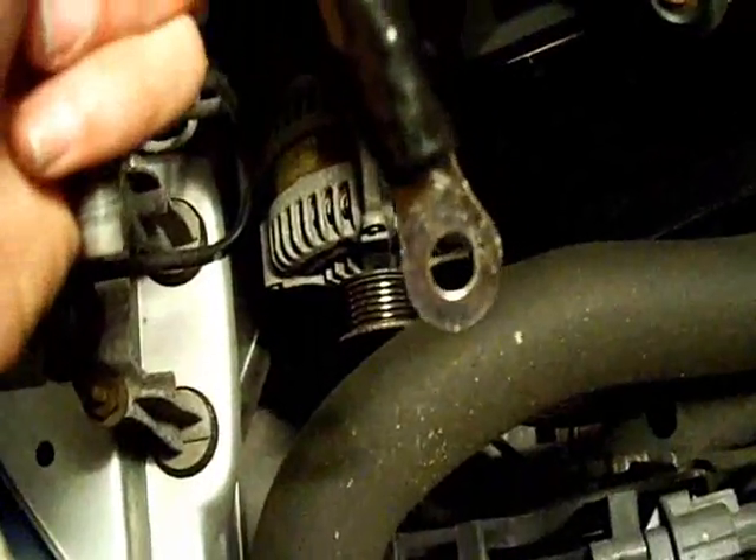It went all the way through because it's starting to bubble out around the wire. I've got my ground on — this is going to go from the engine block to the negatives on the batteries. I took the bolt out of my alternator, putting that back in. I can't see it, but here's the bolt — put the wire on and tighten that down. That's it.